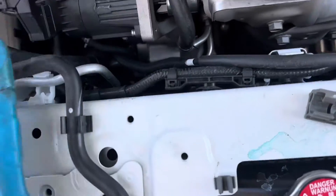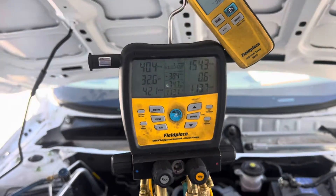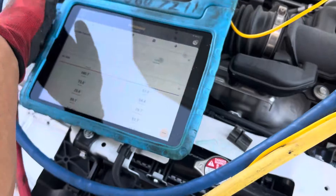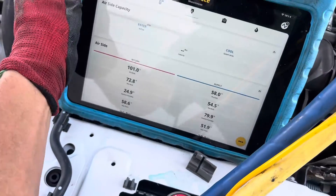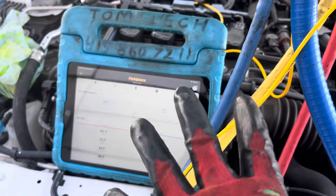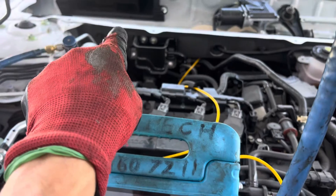It's far away from the compressor. Does this one have a muffler? There's a muffler down there. You can almost think of a muffler as a mini accumulator. So where are we sitting right now? We now have 101 degrees going into the evaporator, because the longer this engine gets hot, the hotter the air going over it.